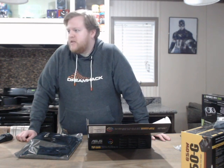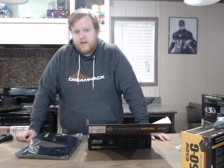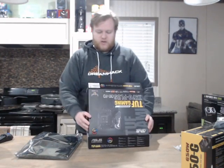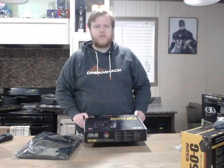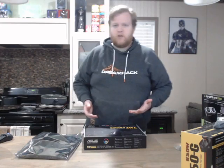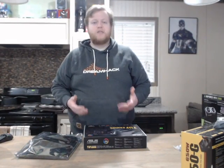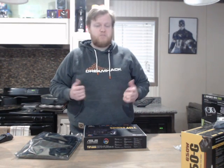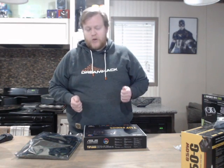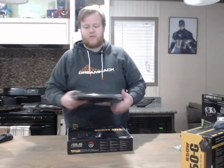When I first built my PC, I didn't do testing outside the case. I went right into installing in the case and stuff. I did the exact same thing, and I regretted it instantaneously. So I've learned from those mistakes. Am I confident I could get this thing built and have it run first time? Yeah, but at the same time, you want to make sure that your components all work. It's much easier to build outside of the case and test than it is inside of the case. Because once I start going inside the case, I start cable managing almost instantaneously, and it's a bummer to have all of that work have to be undone and then redone.